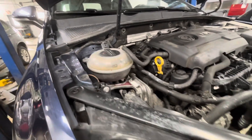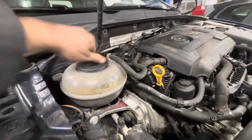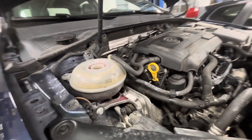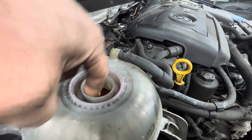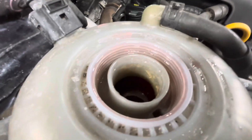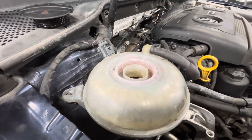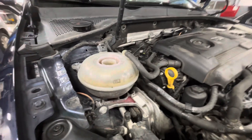What I like to do is: transmission fluid smells really strong. So you can open the cap and if you stick your face in there you can smell what trans fluid smells like — it's very strong. You can see it has a film right there of oil. This has basically no odor at all other than the coolant smell, so it's motor oil. I'll show you what to look for on these.